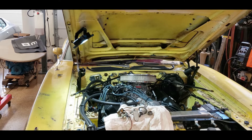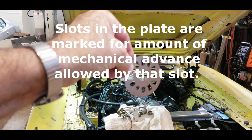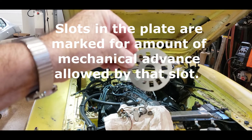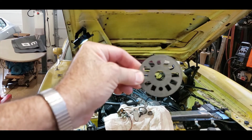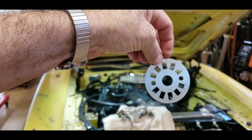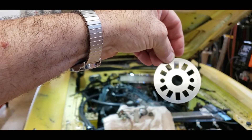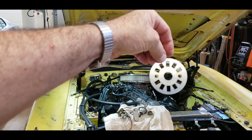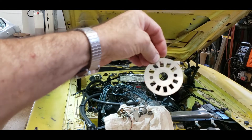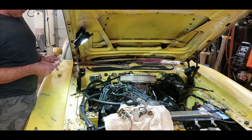FBO Ignitions makes this little device — you can't really see too well on camera, they're just laser etched, but each of those slots has a different length. Each little rectangle is longer or shorter, and then the two round circles can be used to lock out the distributor — it will have no mechanical advance if you use the round circles. I'll show you how this goes into the distributor.